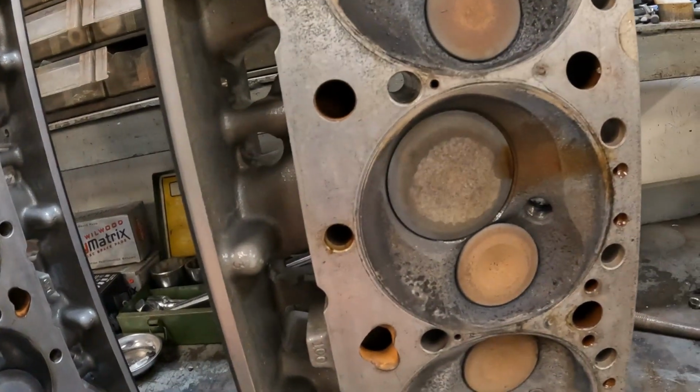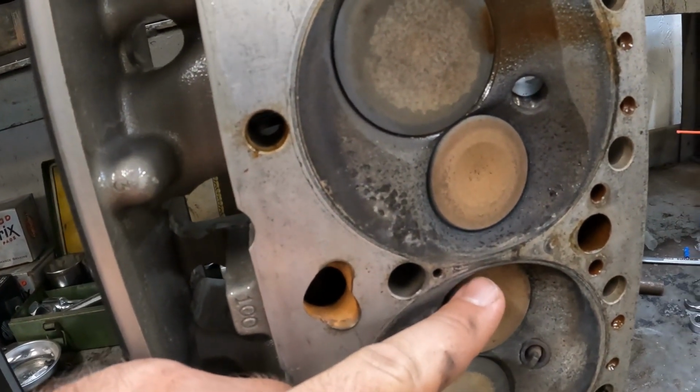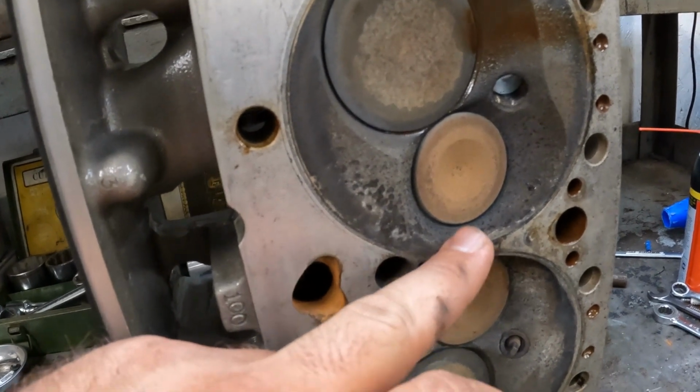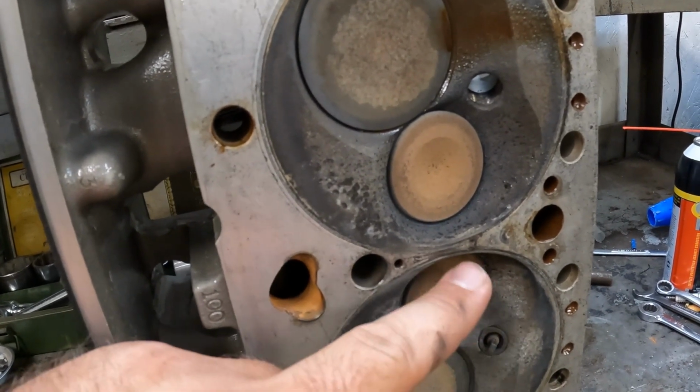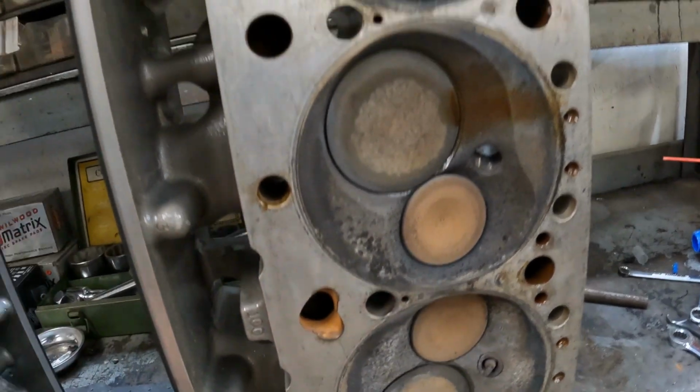Right, yep. And the other thing is, when you get any kind of blow-by between these cylinders like this, one common thing is, in between these cylinders, you'll actually what they call torch the head. If it starts bleeding compression past that, it'll basically burn that land out of there. All right, so luckily it doesn't look like we did any of that. We didn't torch anything.